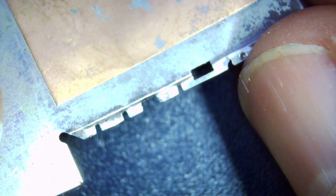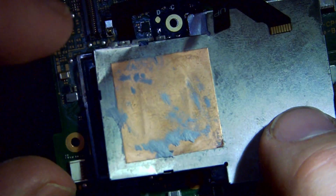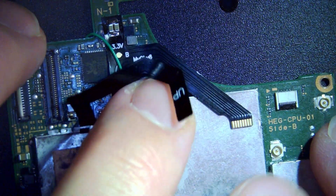On the top edge of the heat shield, slightly bend up all the tabs at the end, because there are a few ribbon cables coming out that you don't want getting trapped. Lift them all up, then reattach the heat shield — making sure you've applied some new thermal paste — and clip all around to make sure everything's back in place.